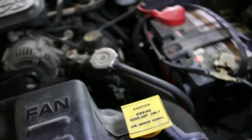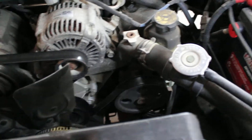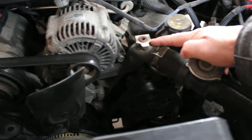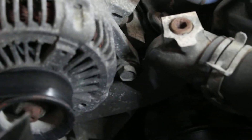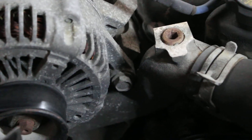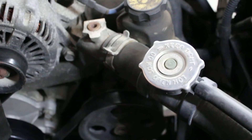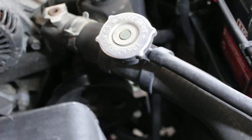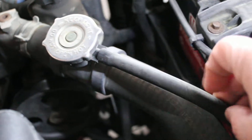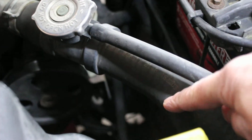At the top of the motor there's an outlet fitting attached to the intake manifold — look underneath the alternator and that's the fitting. The coolant, after it's gone through the motor, comes out of that fitting and travels through this hose. There's a pressure cap here, which is explained well in the attached video, and a small upper hose that flows down to the reservoir.